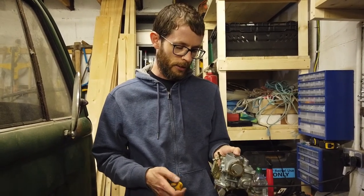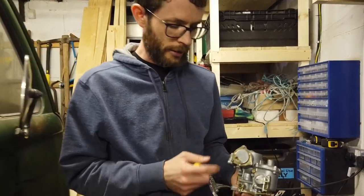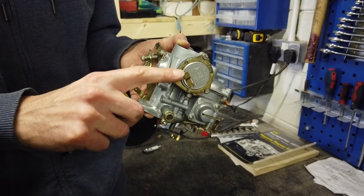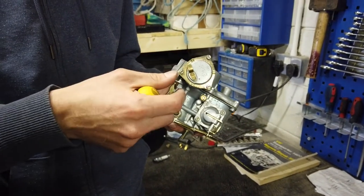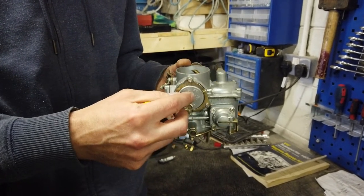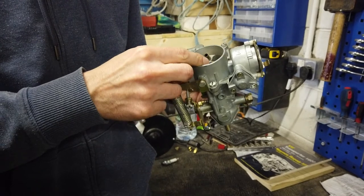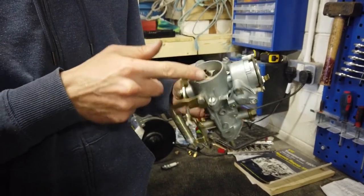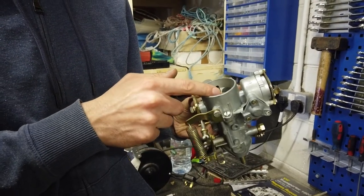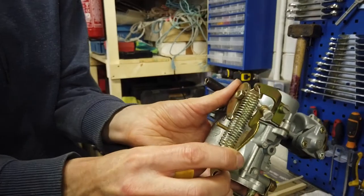The way it accomplishes this is quite clever, actually. There's a little bimetallic strip in there, which is connected to the battery here. When you turn the key on, this gets power, and the strip starts heating up when electricity is applied to it. As it expands, it gradually moves this butterfly valve forward and forward. Actually, this butterfly valve is part of a long bar that runs through here, and that bar keeps getting rotated, and this bar also rotates this stepped cam here.